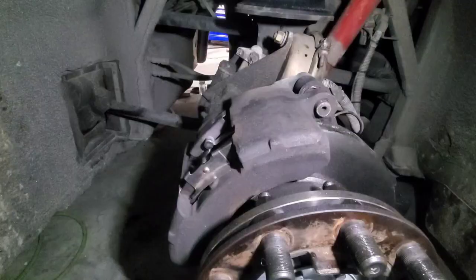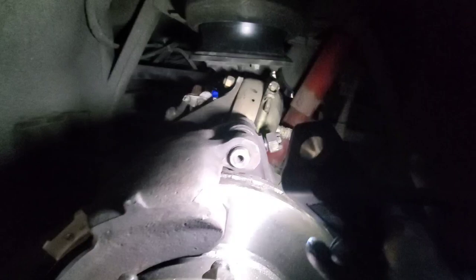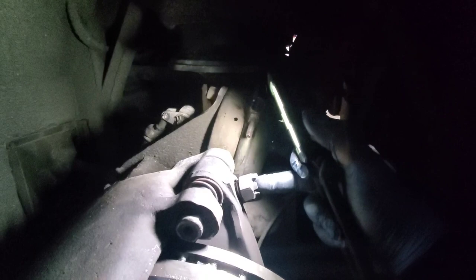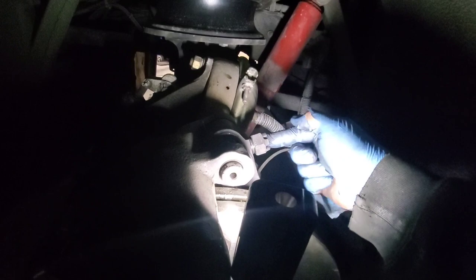Got the brake caliper back on there. We've got the pins pushed through — putting those pins in, I just tap them through with a brass hammer. You want to use a brass hammer to make sure you don't damage the edges of these. The side with the threaded hole is facing forward, and when you put these in you're putting them in just until they're sticking through the back side. There's a spring right here that goes in before you put that pin in — it's a spring-loaded bolt which has to go through before the pin goes through because this is actually what locks it. A little trick when you first get these off: take your brass hammer and just give them a hit if they're seized up — that'll get them moving so you should be able to take your finger and just push them when they're loose. Now that we've got the bolts where we want them, we're going to tighten these down and put our cotter pins through them to lock in our pins.